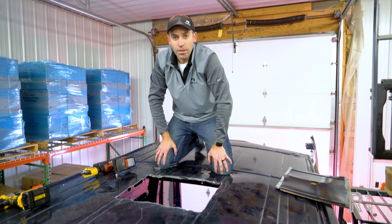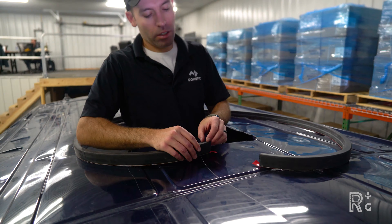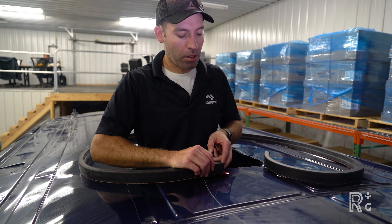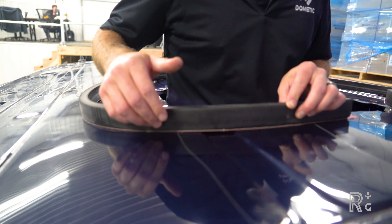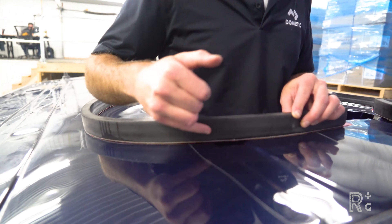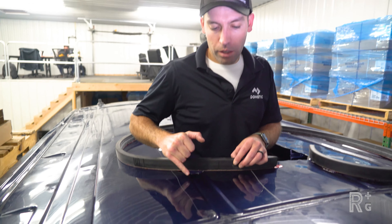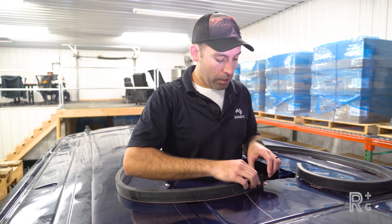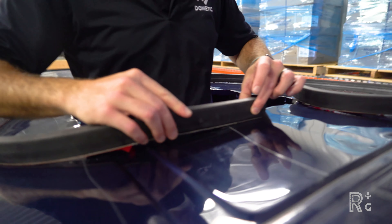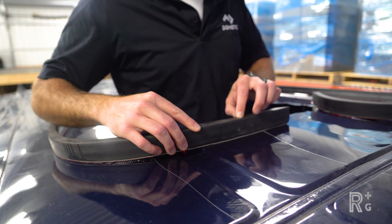We've got our hole cut in the roof and we're back on top with it all cleaned up. We're going to start laying down the gasket. I've made a diagonal cut in the gasket to give us a little more surface area, because we are going to use some RTV sealant — that'll help give a bit more area and offset that seam. As we come along the ridges, we'll try to stick the gasket down into them, but we're coming back through with a bead of RTV to fill in any gaps. There's also a blue back gasket in the install kit — you can cut a small section to fill the gap — but this area is so shallow we're going to fill it with RTV rather than the blue gasket, which would end up sitting a little bit taller. We're positioning this directly over the support for the roof.